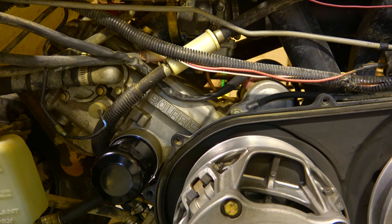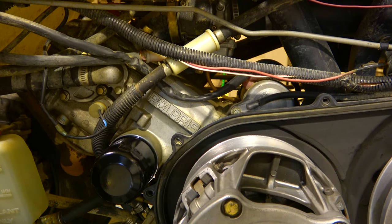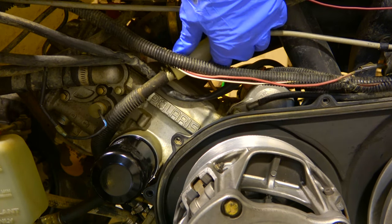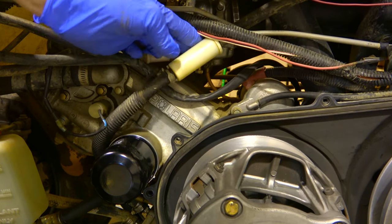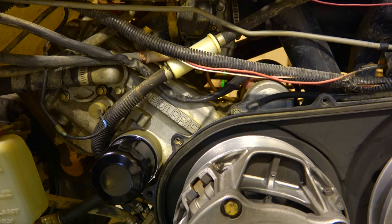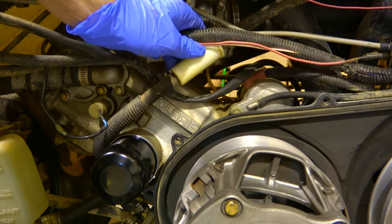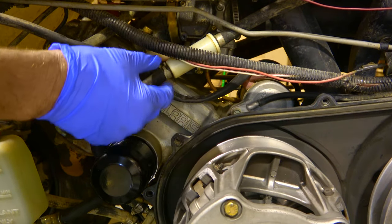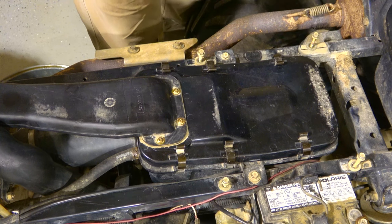One other little nugget — I'm not replacing it now but I want to point it out. You have the breather hose line going from the top of your reservoir to the air filter box. Coming back from the air filter box is an inline breather filter — looks like a fuel filter, just plastic. It's a relatively cheap maintenance item. The large filter in the box is a pre-filter for this. It is directional, so if you replace it, follow the instructions. You just take off two hose clamps, pop it out, put a new one in.